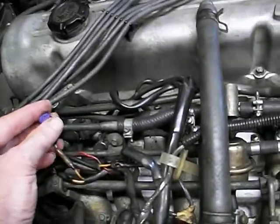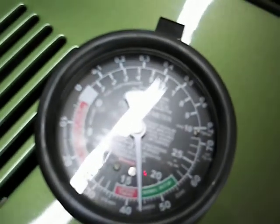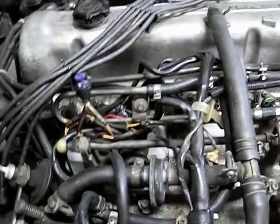Now I will take away the 500 ohms. First of all, you'll notice the engine seems a little bit less stable at idle — it slowed down a little bit. I dropped down to just barely 17, and it sounds a little bit less happy. You have to speed it up a little bit to make it happy again. But I adjusted the idle and the vacuum didn't come back — not what it was originally. So now it's leaned the mixture out.